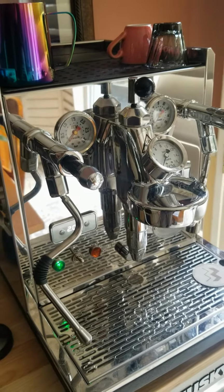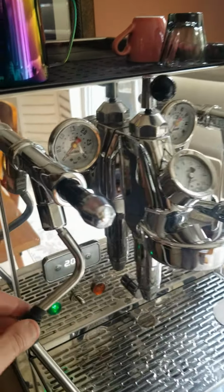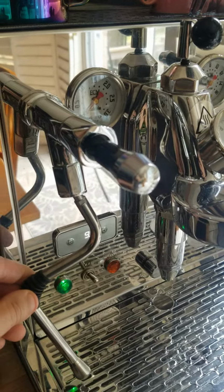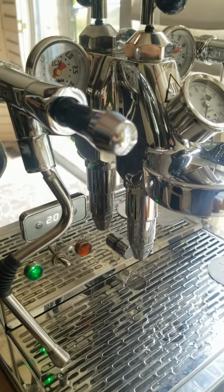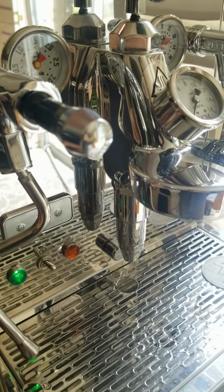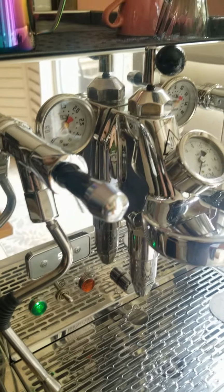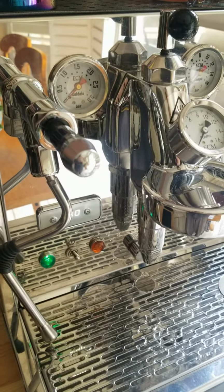It's the opposite problem of scale. It's corrosion, that it might cause micro pitting in the boiler, and then you can cause leaks in like the welds or whatever. So some people have had that issue apparently. I don't know with this machine particularly, but it could happen. So something to be aware of.